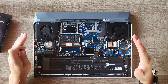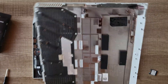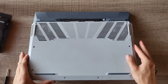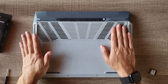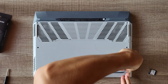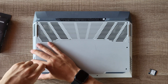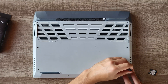Now it's time to put the laptop back together, fire it up, and I'll show you how to partition it. Putting it back together is as easy as taking it apart — and again I'd recommend cleaning up the fans while you're in here. The tabs on the back go in first, they just slot in. Once it's in position you can start clipping it in and then screwing it down. Note that some of these may not click until it has been screwed down, so it's okay if it's not all the way there until you screw it in.